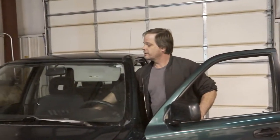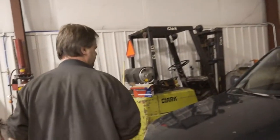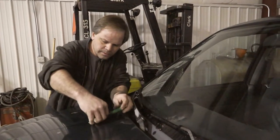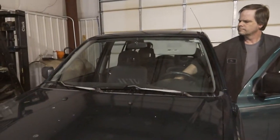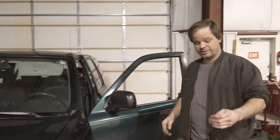After reconnecting, the spray is hitting too low on the windshield — we need to adjust this nozzle. It's hitting about here when it should be hitting more towards the middle. I stuck the small end of a pick into the end of the nozzle and rotated it upwards — a little more like it.